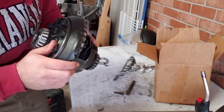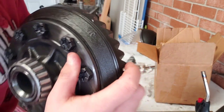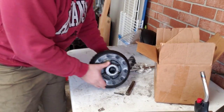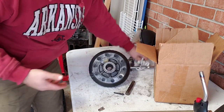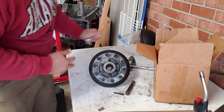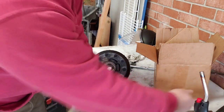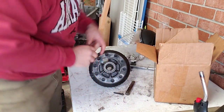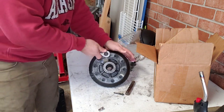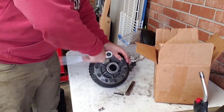And I was just looking at the ring, and they're stamped 410. I am going to still count the teeth, make sure. I am probably going to change this car over to, I think, a 373, because I am going to drive the car on the street some. I could use a 410, but a 410 with a Powerglide on the street, if I get on the highway cruising, it'll probably get pretty rough.